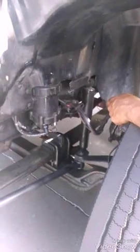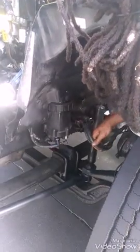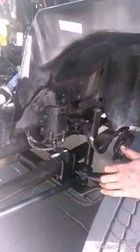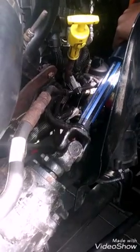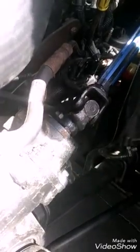And once again, we would check our shock on this side, see if it has any leaky fluids or anything, and check our air hose for cuts or breaks. But there are no cuts or any breaks. So next we'll grab our steering wheel here. And when we shake it, we're checking this U joint here to see if there's any play in there, if it needs to be replaced or not. Everything's pretty tight with the U joint and the steering.